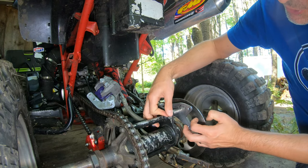With the adapter component came a new e-clip, washer, and longer foot peg bolts — that's going to be handy because there's my original foot peg bolt and it wouldn't reach through a peg and an adapter. Making the guess that CTI is going to stand up right here, it looks like the adapter is going to sit something just like that. Let me put some lithium grease in the one I pulled off. And now I see my pedal is bent — I think we would go something like that. Yeah, this pedal is probably super bent.